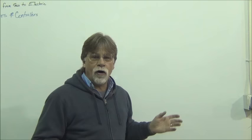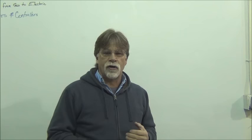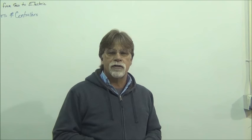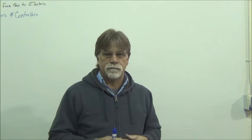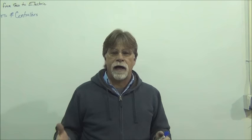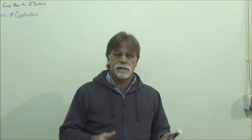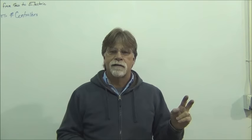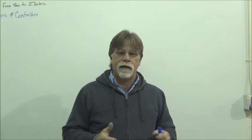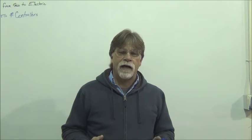And so we've shown that in other videos. We started off originally with a Curtis 1231C, a very popular controller in the earlier days, air cooled. We added liquid cooling to that, but too little too late, it died. Then we went to an Evnetics, about the same size controller, because we were trying to do an equal comparison, basically a 500 amp controller. The difference was that the Curtis, because it was air cooled, was 500 amps, but only for 2 minutes. And then it would have to back off power to maintain cooling and keep from overheating. Whereas the Evnetics was rated at 500 amps continuous because it was liquid cooled.